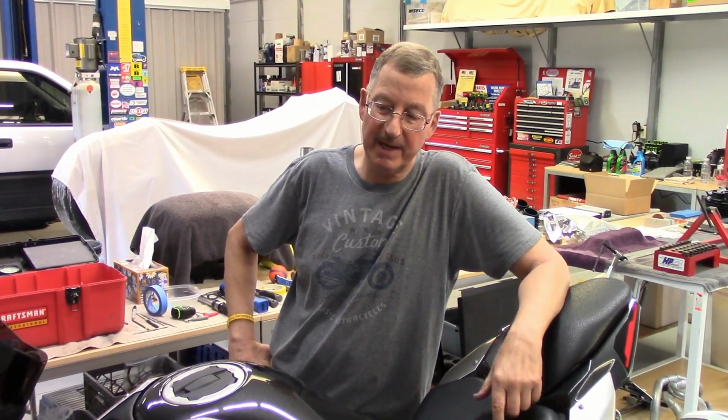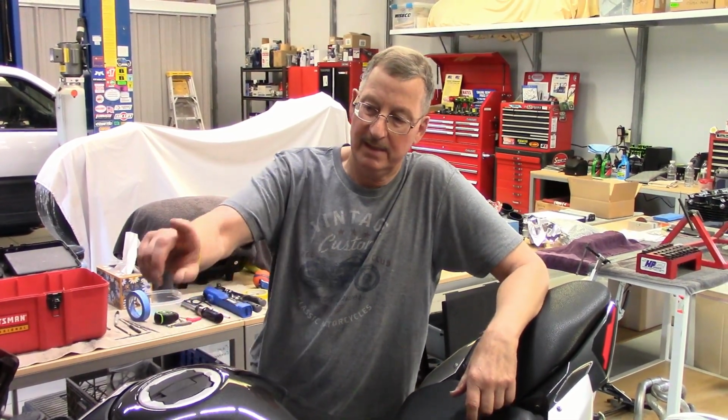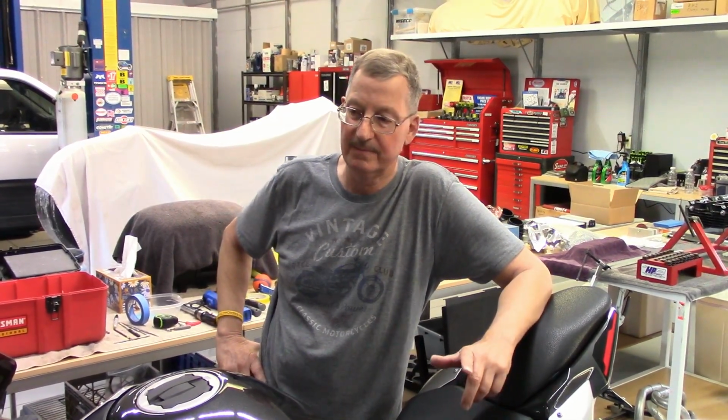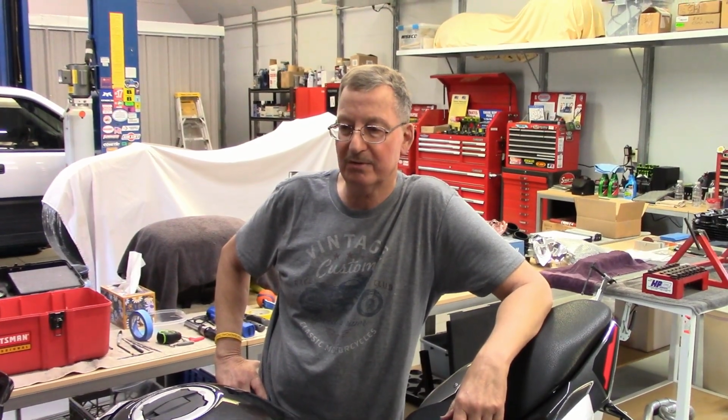Alright guys, let's fire the bike up. Like I say, I've got the launch green on the right, set at about 3 grand. I got the left shift light backed way down from 12.6 to, I don't know, 6,200. So I'll show you what it both looks like.